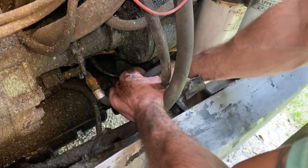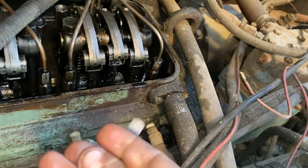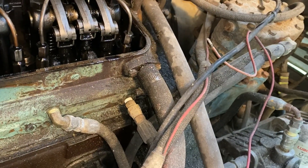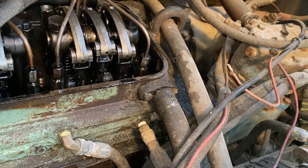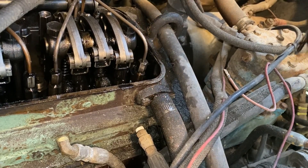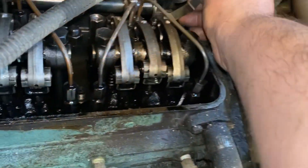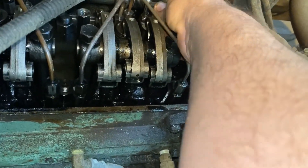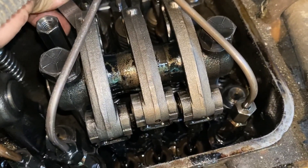He's barring the engine over using a small pry bar that fits between the bumper — we can't get the bumper to open up. I'm getting ready to check the exhaust valves on this cylinder. This is a 15/17ths — 0.015 and 0.017. The 0.015 should fit; the 0.017 should not. These are the exhaust valves on a 4-valve head. You can see that it goes in and then stops as soon as it hits. That one's good.